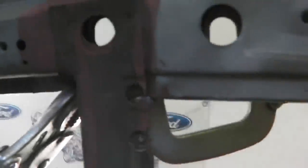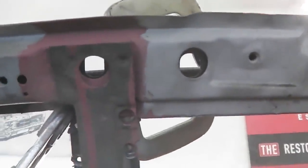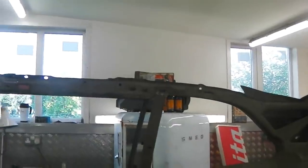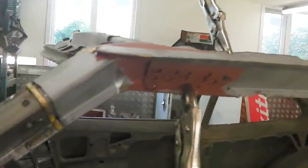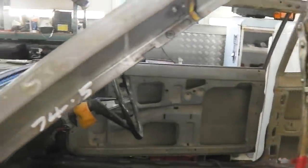That's the inside face. Let me see if I can do this for you. Flip the camera around. That inside B pillar edge to spinning you all the way around to this edge, 72 mil, and indeed the car outside the Portuguese shell gives 72 there as well, and we've got, sorry, not 72, 47 mil, and that's the same on that side. So we've got the relative positions correct for the B pillar to the A pillar. We've got the windscreen aperture correct, so that's this up and down.